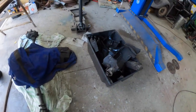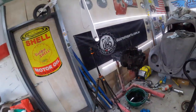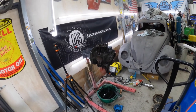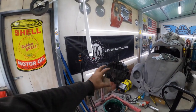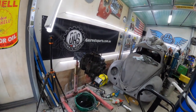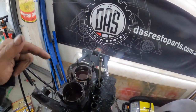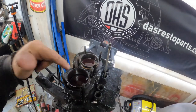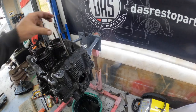We've got a whole box full of stuff here that we're going to have to clean. Here's the motor. In the last episode — links in the description if you haven't seen it — we started tearing this sucker apart. This is a 25 horsepower motor which came with the ambulance. This thing here is seized. We're trying to pull it apart. I've put some AT fluid, some WD-40, let it soak overnight, and I'm just trying to get the cylinders out. The pushrod tubes are not having it.